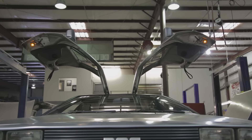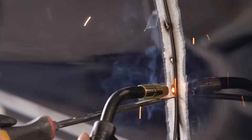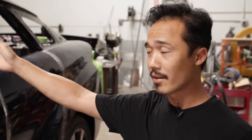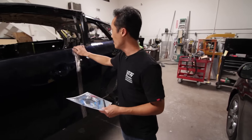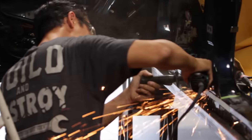The hardest fabrication is making these Gullwing doors. Because this was a four-door, we have to make this car into a coupe, so that's the challenge that we have ahead of us. We had to do a lot of welding, we had to build an understructure, because we're going to cut up a lot of the structural integrity of the car. So we cut the B pillar out, we shortened the rear door, welded it to the vehicle, and we're lengthening the front door.